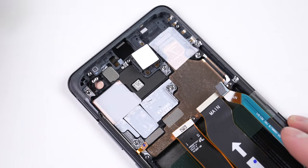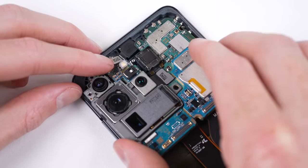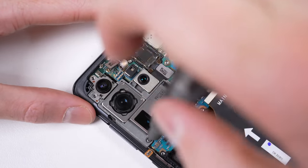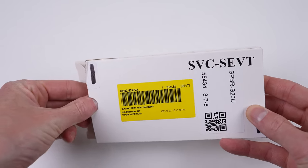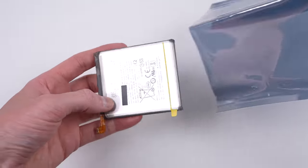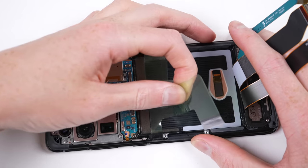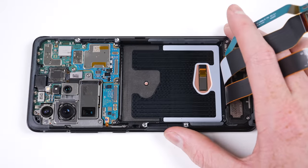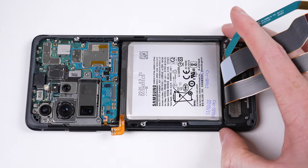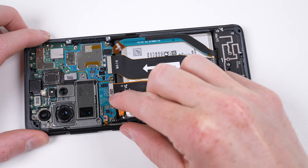Up at the top of the phone, it's time to get the front-facing camera reattached. I'll then be sure to remove any plastic film before installing the motherboard into the phone. Now comes time for the new battery. The original is in unknown condition, and while it would likely work, it's several years old, and like all batteries with age and use, come significant wear — if I'm working inside the phone, I might as well spend the $20 to replace it. Once it's in, I can reattach both charging port cables, the new display, and finally the battery.